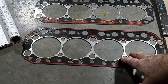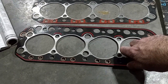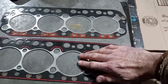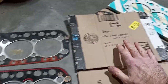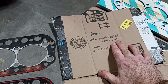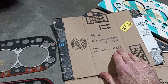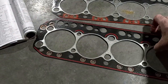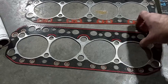What concerns me with the Lucas is that it's actually thicker and heavier than even the Payen. When I used the vernier caliper on it, measuring around various places on the combustion chambers and comparing them, the Payen averaged about 51 thousandths. The Lucas is about 10 thousandths or more thicker. So that is going to affect and lessen your compression ratio.